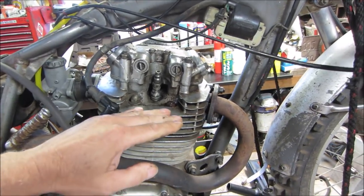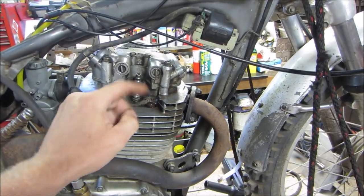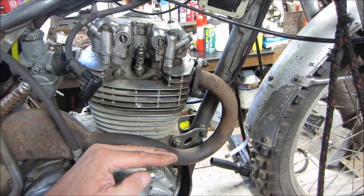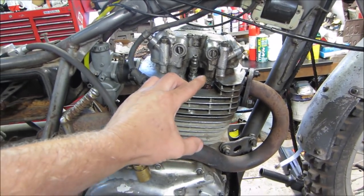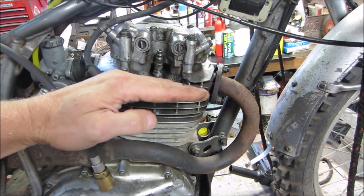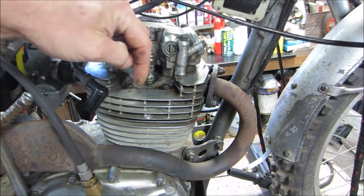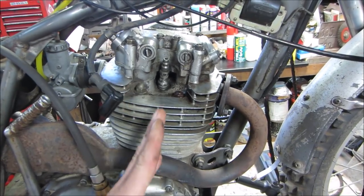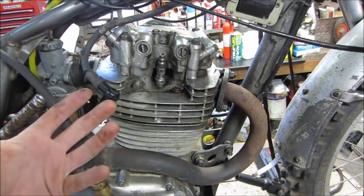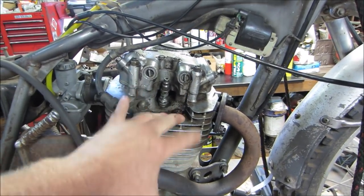Also, leak down test, you have to do a top dead center on the compression stroke, and you need to lock the crank from wanting to turn one direction or the other. If the piston's all the way up, you put air in it, if you're not dead center, and you're never going to be dead center, it's going to want to bring the jug back down to bottom dead center. And the reason why you want to do it at top dead center is most of the wear in the cylinder is going to be right where the compression happens and the fire happens. So it always is getting a blast at top dead center, and it wallows out the top of the cylinder right there. If you were to look at it, it would be a very slight cone going into the top where all the work is happening under that compression stroke. Once it's about halfway down, there's really not much happening anymore. So you need to lock the engine in the top dead center with the valves closed for that to happen.